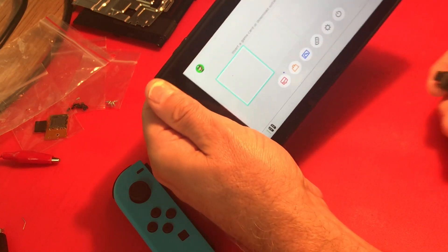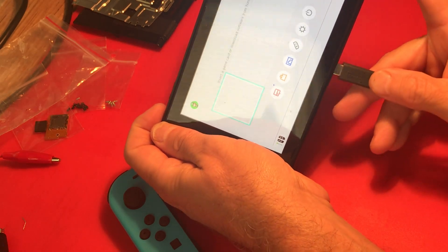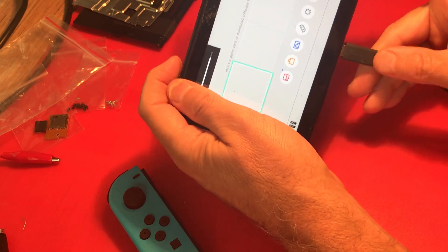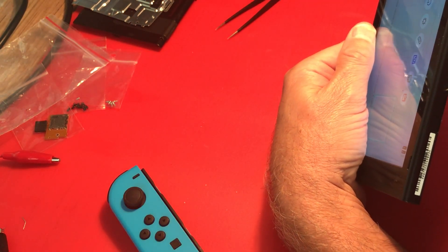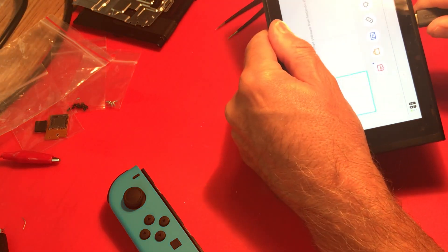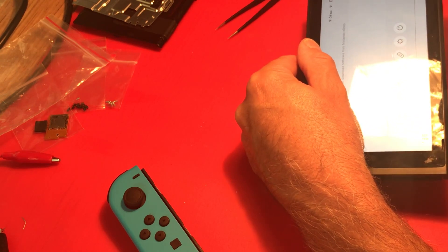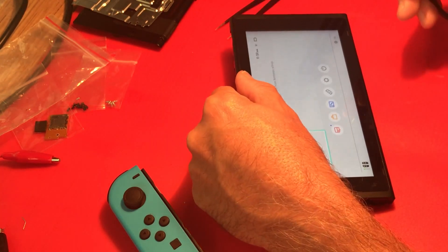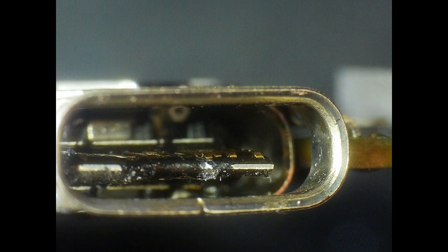What I want to see now is: do we have a charge indicator when I plug this in? I don't think we do. I hope I have a damaged charger here - this came with it and I'm not really sure of its status. Look down in this thing - this is about the point I realized I had damaged the connector when I soldered it on. You can see I melted the leading edge of the USB connector. That's why the cable wouldn't plug in there properly.